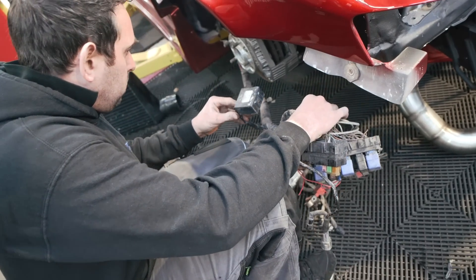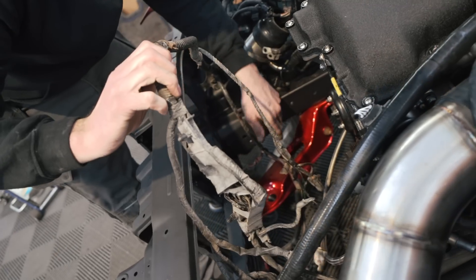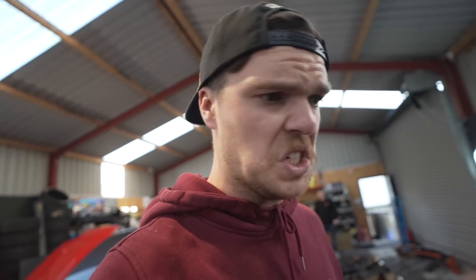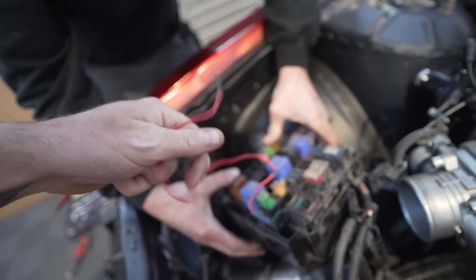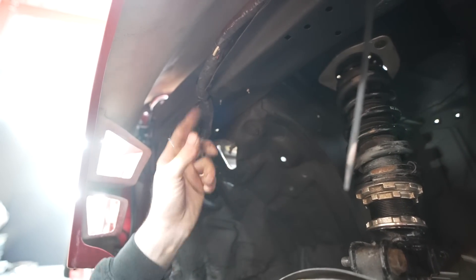So Wayne, you dismantled the fuse box. Our plan was originally to try and relocate it, but we got told an S14 is much harder than an S13 for that. So we're now just putting it back in the engine bay with a fancy cover so it'll look a little fancier. We may need to tidy the wiring later because it looks ugly and dirty — there's wires coming everywhere, loads of connections going everywhere. The loom is going on top of the arch. It was cut out and notched out already. Bring the wire up across and along where the wheel's not going to hit it, and file down any sharp edges — because health and safety is important in the workplace.